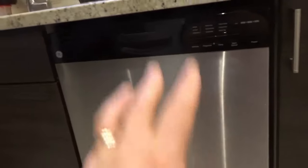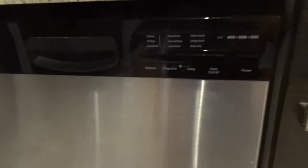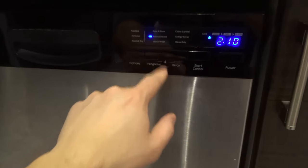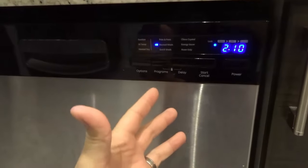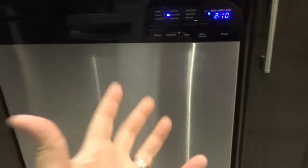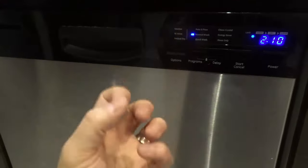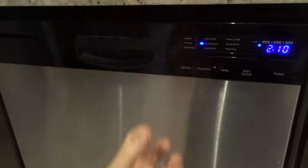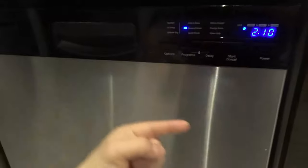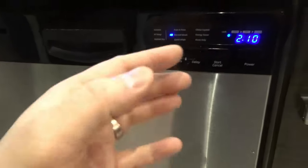The first thing that you want to try is allowing the dishwasher to run a regular cycle to allow it to naturally get rid of the water. When you turn on your dishwasher and start a cycle — say a normal wash — when you hit the start button, in most cases, most dishwashers, the pump will drain the water at first. So you hear the pump going and it's draining the water. Then it's going to pause for a few moments and then it's going to fill with new water. And that's the first step.